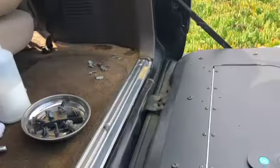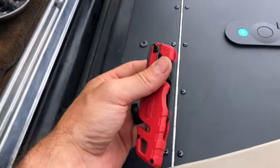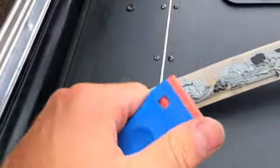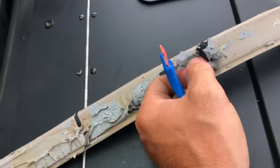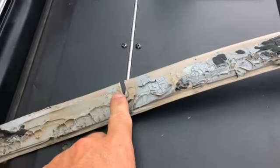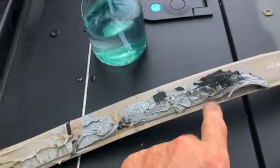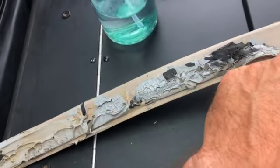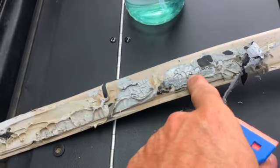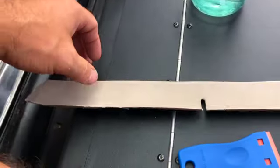To get this panel off I had to use a box cutter knife — you can use any kind of knife really. Then I'm using a plastic scraper to scrape off as much as I can. After that, to get off gooey stuff like this — once you get the bulk off, you can use alcohol in a spray bottle, spray it, and use the scraper again. Alcohol eats away at sticky material, so if you can't get the bulk off, just spray it, let it sit, and keep working it.